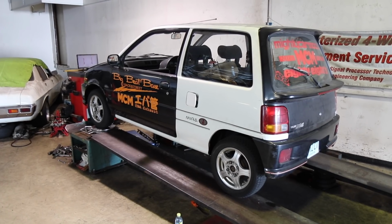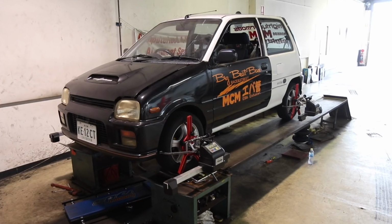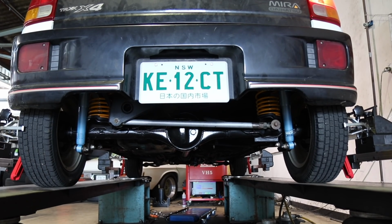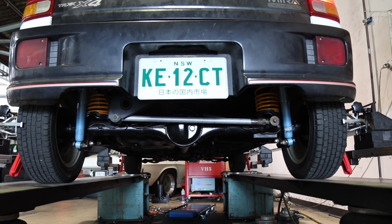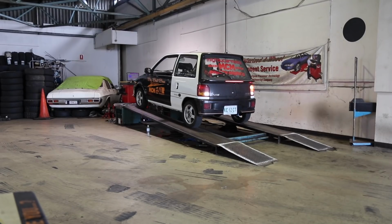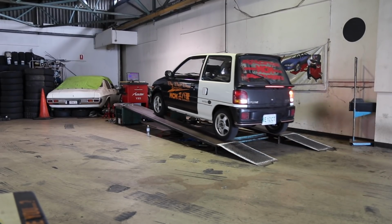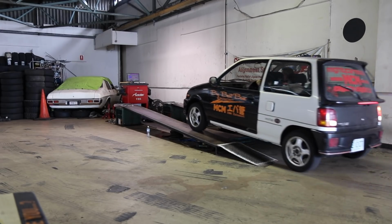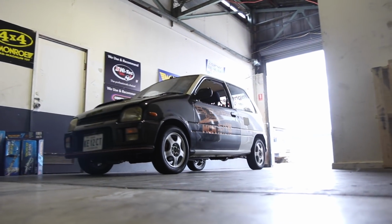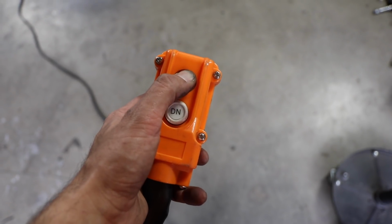The wheel alignment is particularly important as the entire car has been in pieces and reassembled with a welder. We need to check that the back wheels attached to the JDM floor pan follow the front wheels from the Aussie car perfectly when the car is pointed in a straight line. This can be adjusted somewhat using the panhard rod that we customised. The rest of the suspension is pretty basic and luckily for us, it's passed with flying colours.